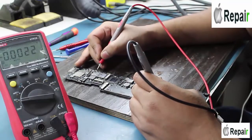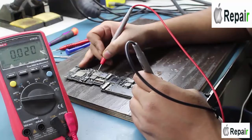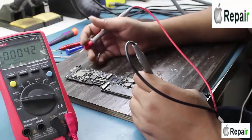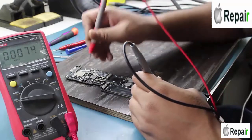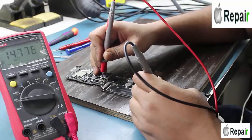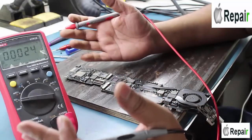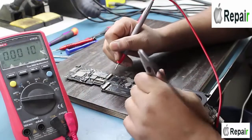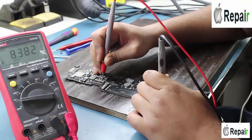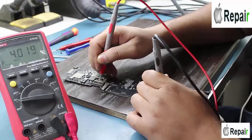The 3.42 volt G3 hot voltage must be here first of all — and it is here, 3.46 volt, approximately right. Then I see the fuse — the fuse is supposed to be a jumper wire — but what I see here is that from one side of the fuse it is 8.3 volt, and from the other side of the fuse it is merely 3.9 or 4 volt.